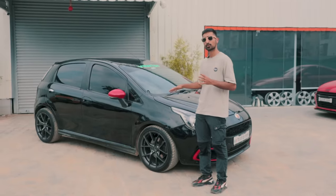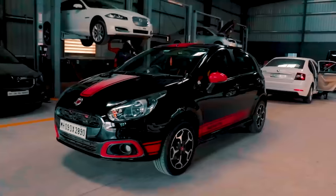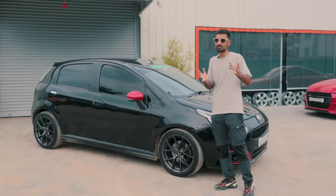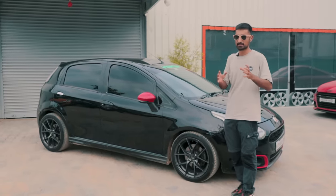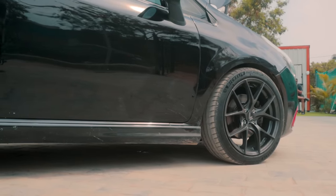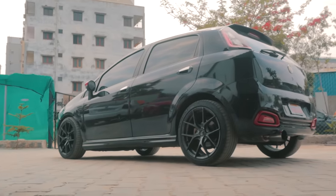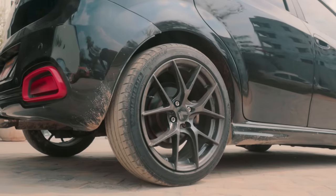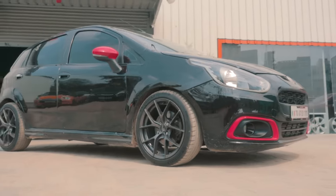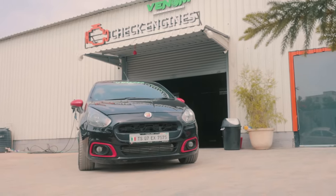When it comes to design, the Fiat Abarth Punto always had the sporty notes that someone would like, with the livery from factory and the dual tone paint scheme. It always looked really good but enthusiasts like a bit of stance, and that was missing because the stock one came with suspension that was like on stilts. This setup is on H&R lowering springs, B8 Bilstein dampers, and these really pretty 17-inch rims from Lenzo. The stance as you can see from the side profile is absolute money, and the livery delete also makes the car look super badass.